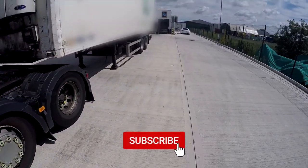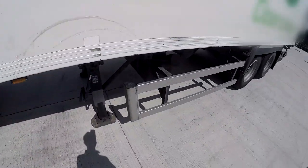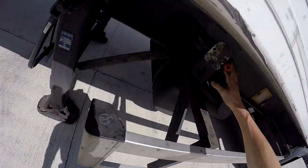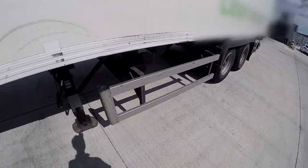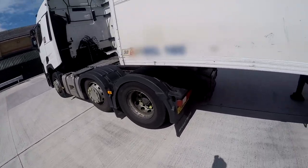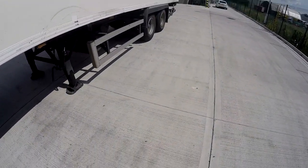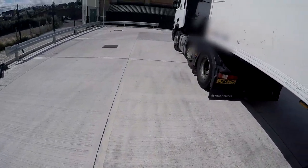Onto coupling then — it's literally the opposite. You start on the right and go to the left. You have to drive the vehicle first, but basically you want to reverse up to it like that. Check the brake is on — that's the big one. The brakes should come on automatically when you take the emergency airline out, which is the red one. But sometimes on older trailers they might not, so just always make sure that's the case. Also make sure it's on solid ground and not tipping over, because if you pick the trailer up with your suspension you might end up tipping it over.